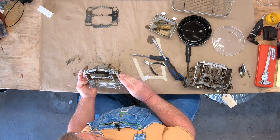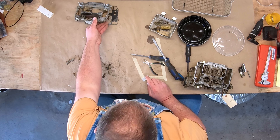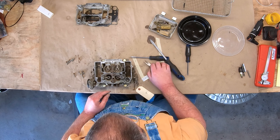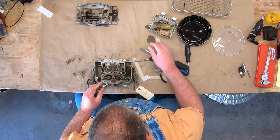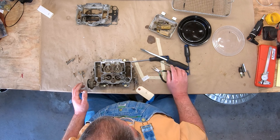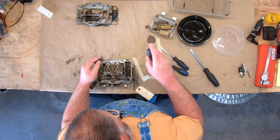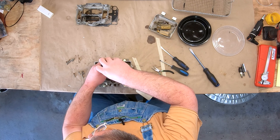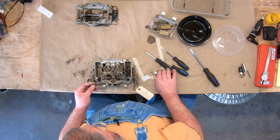We've got this cleared out — that part's completely stripped down. Now we come onto the main body. There is the return spring for the accelerator pump right there. I leave these little baffles in — they don't really need to come out, especially if you're using the ultrasonic. That's a hot compensator — pull that out. This basic carburetor design was used for decades, so yours may be different from this one, and that's okay.